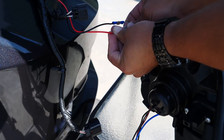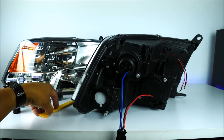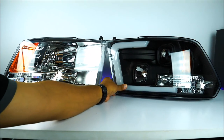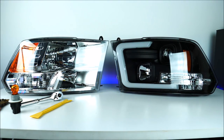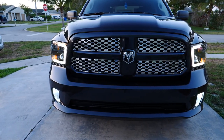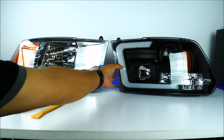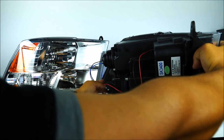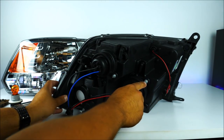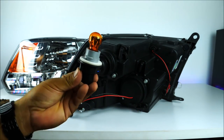All you have to do is put it in there, add a little bit of black tape so they don't touch each other, and that's pretty much all you have to do for the headlights — super simple. I've now completed both the left hand side and the right side of the vehicle and you can see how different it looks from the standard headlights. These are definitely nicer looking. On the back side, you can tweak the bulbs in case they are unbalanced using these adjustment knobs — I think it's an eight millimeter socket to adjust them.